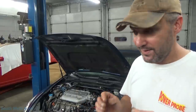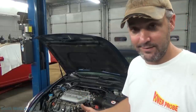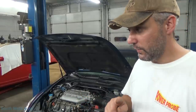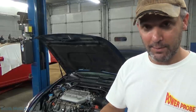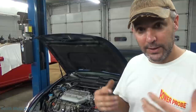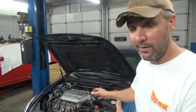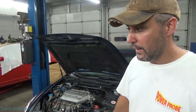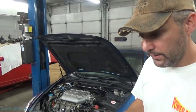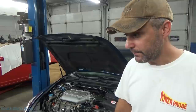There are going to be situations where that is the absolute best option, and it's good to practice and learn on good engines and bad engines. That way you can build your library, build your knowledge base, and hypothesize what's going on. Especially on a car like this where we know there's a bad exhaust valve — what can we learn from those waveforms? And it got to the point where I couldn't learn a ton from the running compression waveform.